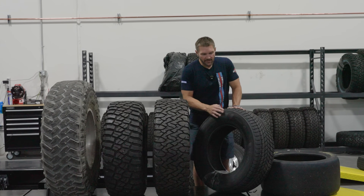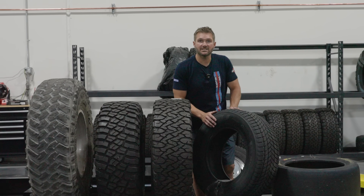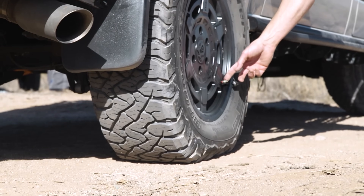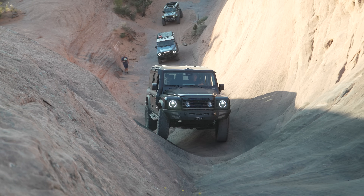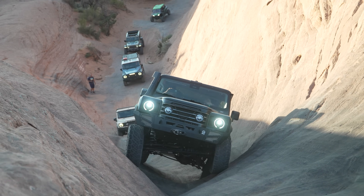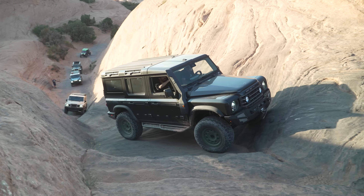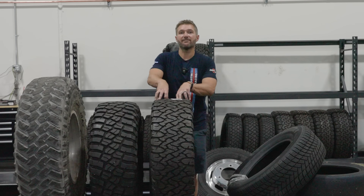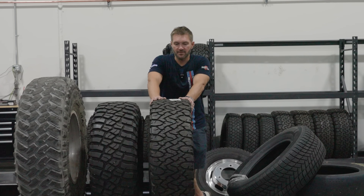A tire like the standard Sprinter tire has no blocks or lugs on the edge, because it's never intended to be deflated. As you deflate an all-terrain tire with weight on it, the tire actually flattens out and those side lugs become part of the bottom of the tread — a pretty cool idea. They also help grip on trails like Moab or the Rubicon, where you've got moon rock, red rock, or granite gripping the sides of trails very well. This is a great all-around tire, and for the vast majority of people choosing tires, my suggestion would be the BF Goodrich KO3.